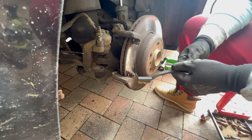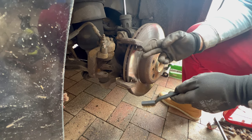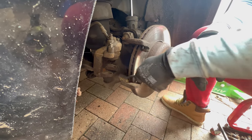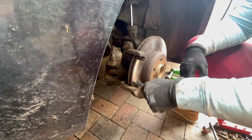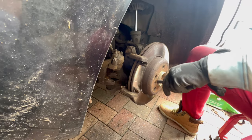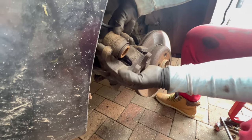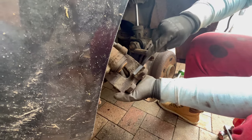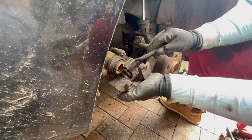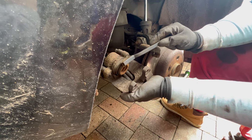You can do it two ways: either remove everything completely and clean it, or do it in situ as I'm doing — clean the parts where the brake pad sits from the inside as well. You can clean the inside of the brake caliper too. When you push back the brake piston you can clean underneath as well — just be careful not to tear the rubber boot.